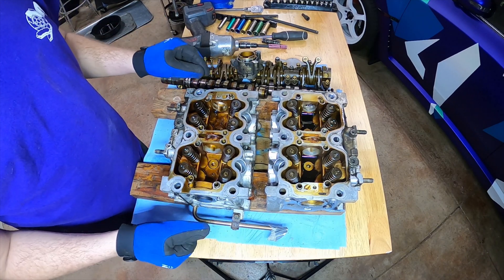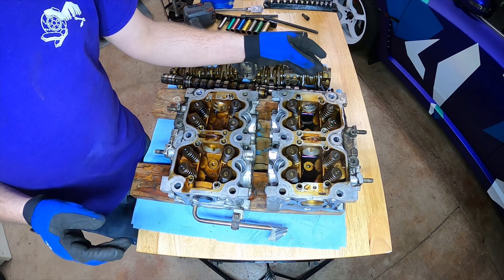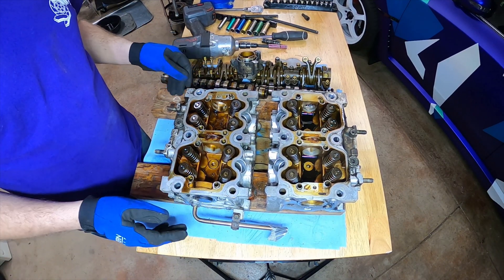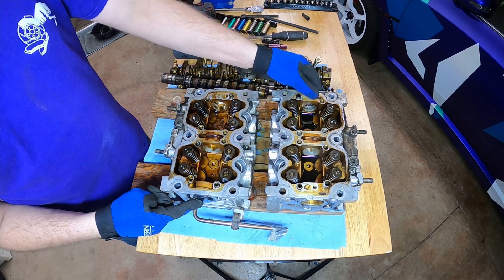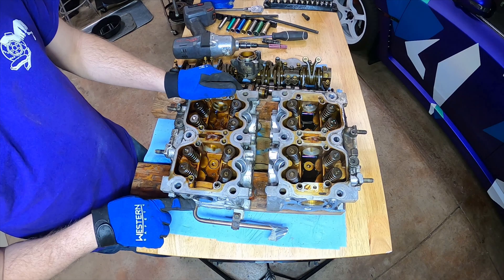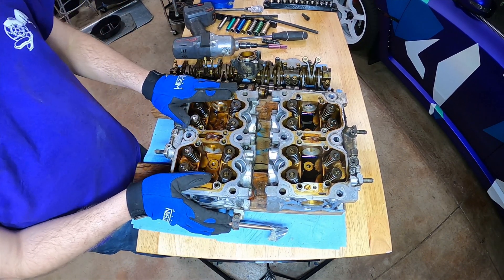We got the cylinder head — there's no excessive wear on these bearing surfaces, also looks good, which means the engine was never run without oil. Now that we've inspected the cams, the next thing we need to do is get this cam plug out, the front cam seal out, and get this EGR pipe off so these can be ready to go to the machine shop. We'll pull this cam plug and cam seal off, then cut this EGR pipe to remove that fitting and take this 10 millimeter bolt off, and these heads will be ready to go to the machine shop.